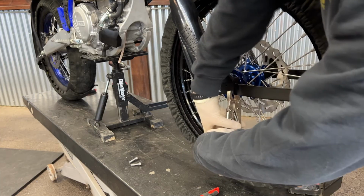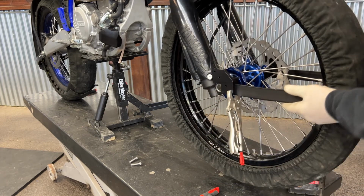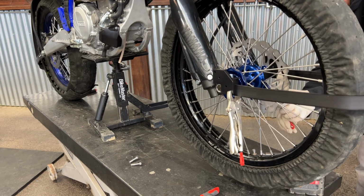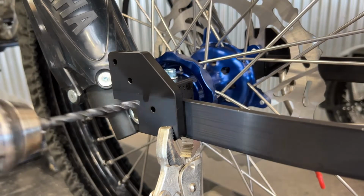Once you're ready, hold the hoops in place, grab 2 pair of vice grips, and you can actually apply the vice grips over the holes. This will allow you to drill the second set of holes and not scratch up any visible surface. Look at your fenders, make sure they're square, make sure the hoops have plenty of room, and then you're ready to drill.